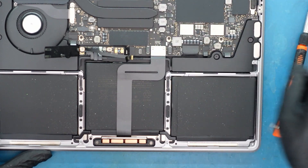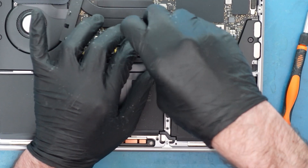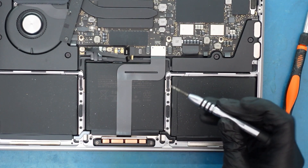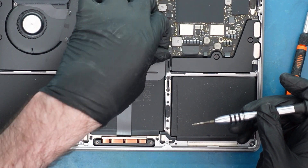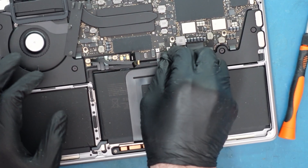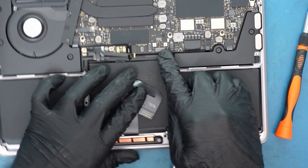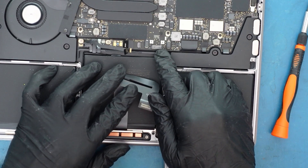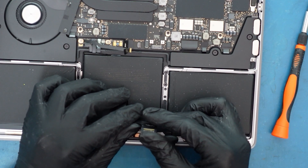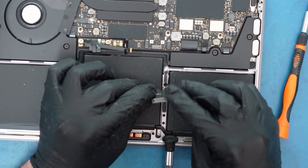If you're ever doing a battery replacement, my recommendation is to make sure that you remove the trackpad too, because it's very easy to damage or get liquid through the battery removal process onto the trackpad connection. So when you're doing this, you want to check if there's a problem with this connection — which doesn't look to be. It looks very clean. Even this cable looks to be very clean too, at least on this side. There's just a little bit of dirt on this, but that's not too big of a deal.